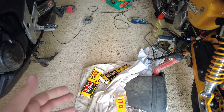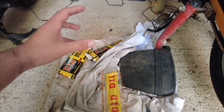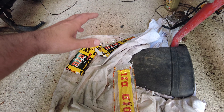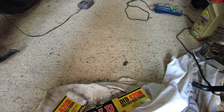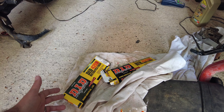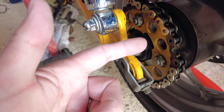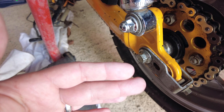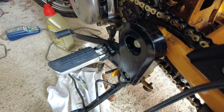So the chain I put on was at its maximum adjustment before this. Because I've put aftermarket parts on with different size sprockets, I'm playing with the chain size because I want the chain to last a little bit longer. I kind of went all out and bought a 94-link chain, but it was about two sprockets away from being able to fit. So then I ordered another one at 96 links, thinking that would go on. And that's left me one sprocket away from being able to connect. I need to adjust it at least to the minimum adjustment. So I'm actually now onto my third chain to make this fit — but once I've got it right, I've got it right.